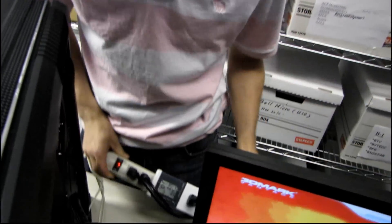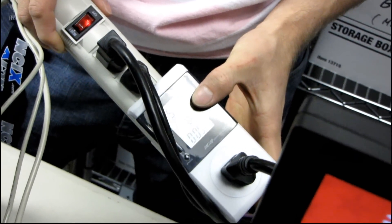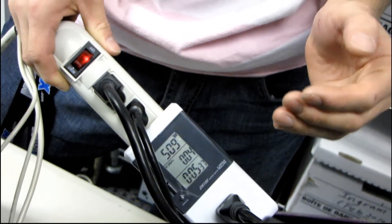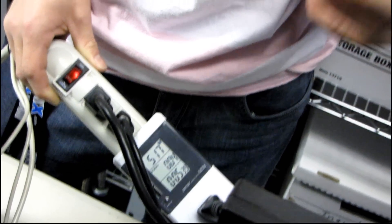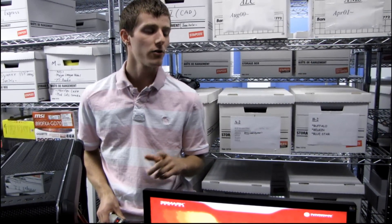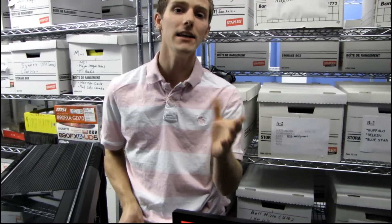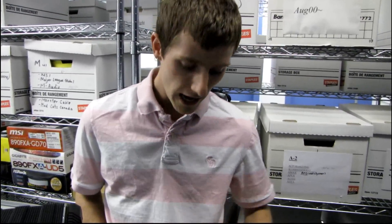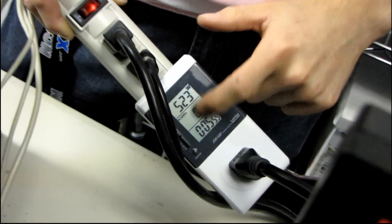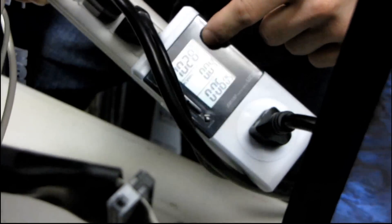When you're consuming 700 watts at the wall, that does not mean you need a 700 watt power supply. A 700 watt power supply would be borderline. Power supplies are rated for how much DC wattage they can output, whereas this measurement is how much AC wattage is going in. So a power supply rated for 1000 watts DC at 80 Plus — say 80% efficiency — would actually be able to supply a system drawing up to about 1150–1200 watts from the wall.